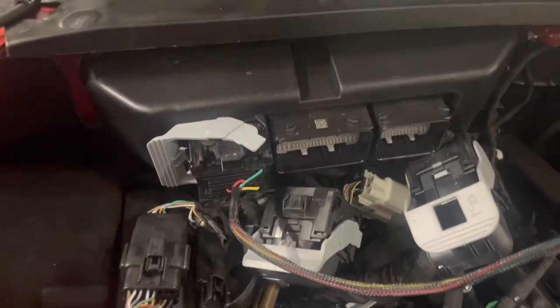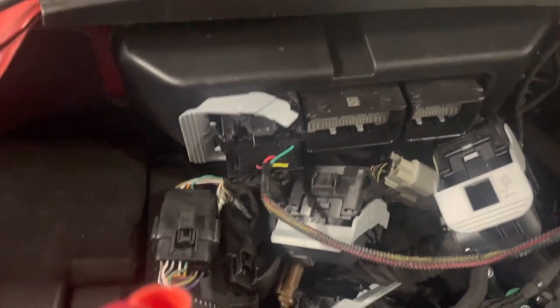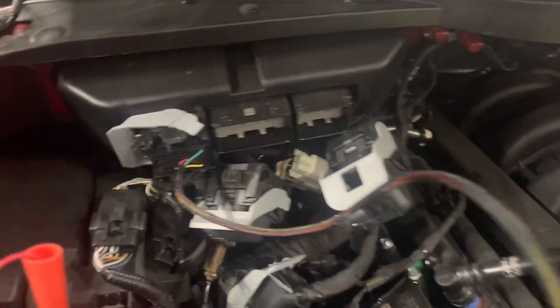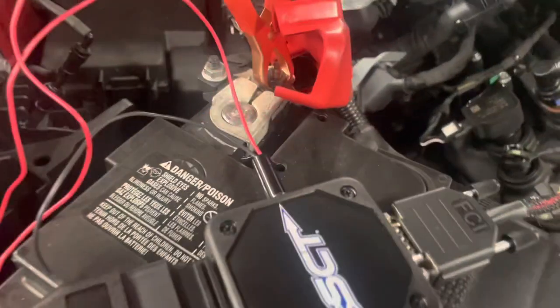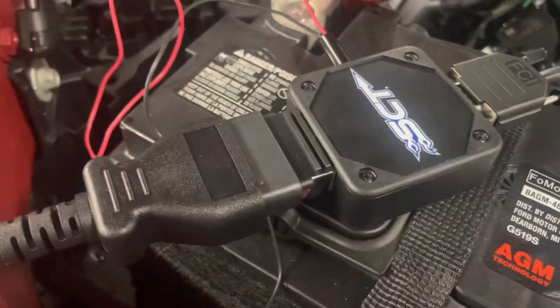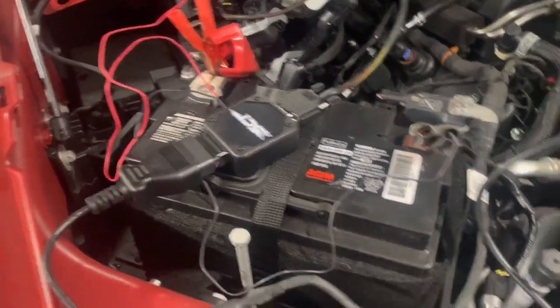When you do this, you are going to unplug all three plugs, and then you're going to use the far left. This is exactly how it's going to look when you flash it. First thing you want to do: disconnect the three plugs, reconnect the SCT plug, plug that into the box, plug the connectors in to get power, and then the X4 into the box. The X4 should fire up, and then you flash it just like you normally would — just go through all the steps.